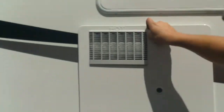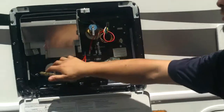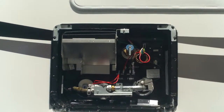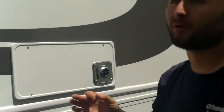This is a six-gallon water heater — it works with electric or propane. There's a drain plug here so you can drain the water. Every time you finish using it, take that plug out to let all the water drain, so on the next trip you don't get that weird smell. There's also a pressure relief valve — if you see water dripping from it, that means there's too much water in the tank.